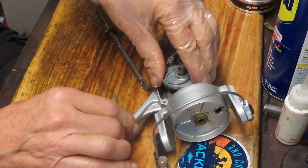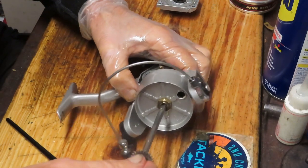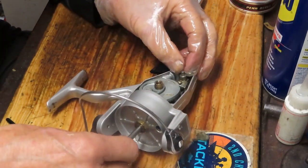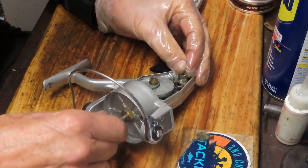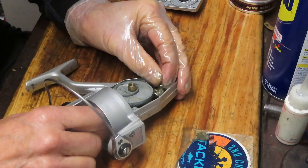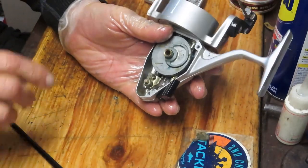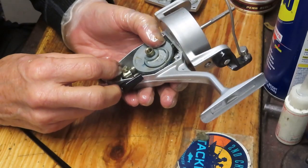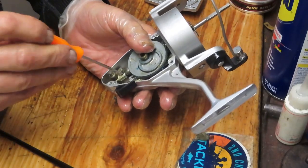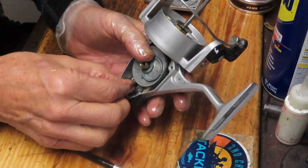Now it is. Main gear, bring your axle shaft in, seat that into your crosswind block carrier. Just like that, there's a hole there. You're going to need to line that hole with the hole in the axle shaft. And you want to grab the screw for that, put that in.